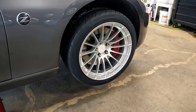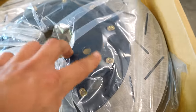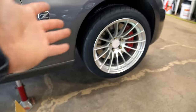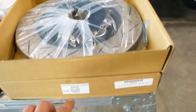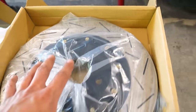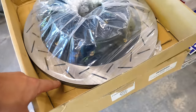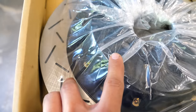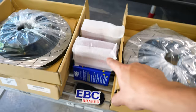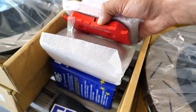The massive brakes on the front are getting an even more massive upgrade. These brakes from Z1 Motorsports are a super-light two-piece brake rotor and outer ring combo. This unit replaces the standard one-piece cast iron brake. The front brakes are the same OEM size — 356mm by 32mm, vented and sprinkle slotted. For the rear: 350mm by 20mm, also vented and sprinkle slotted with the same two-piece design. This is going to save a ton of weight. I also picked up EBC Red Stuff brake pads for both front and rear — a great upgrade over stock.